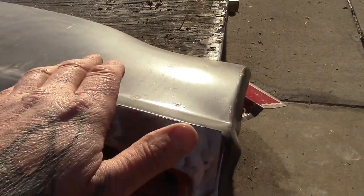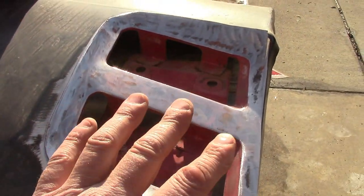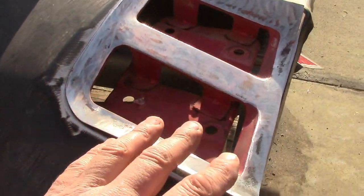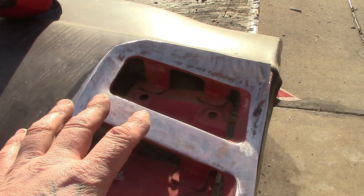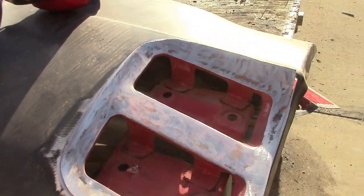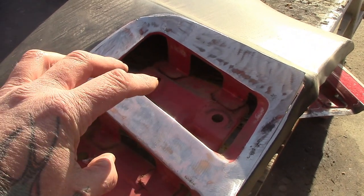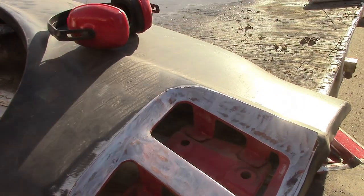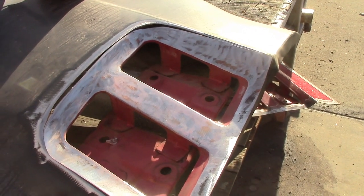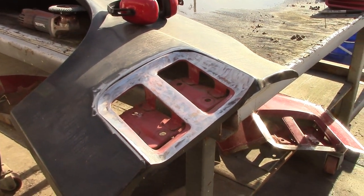And what I'll do is I'll only put a couple little butt welds in it, and then I'm gonna fit the quarter panel to the car. And I'll finish this off when it's on the car. But I wanna get it tacked in place right now. The reason I won't finish it off here is I put a couple little stitch welds or little butt welds on there just to try it on the car to make sure that everything is lining up inside the car itself, because you have to be able to get through these to the rear quarter glass. So if I'm slightly out, it could throw stuff off. So I wanna get it exact. And again, measure many times, don't be afraid to measure, write it down, keep track, and away you go. So that's what I'm up to here today, so I will continue on and see how far along we get.